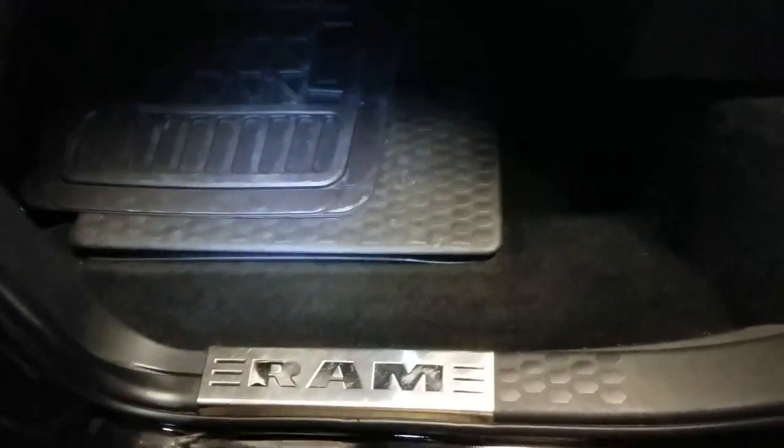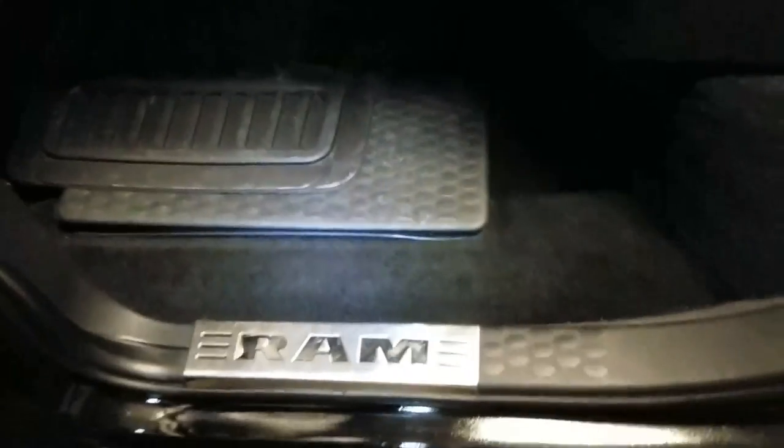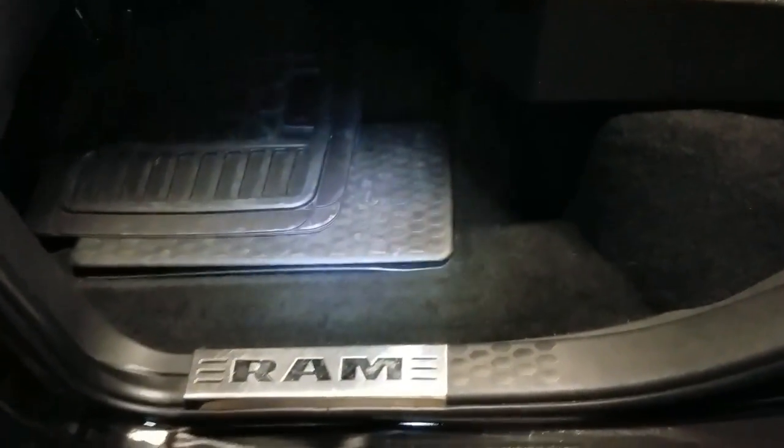It is oxygen free copper. I do have a step down that goes from zero gauge to four gauge to the amp, because the amp only accepts four gauge. The amp itself is installed in the storage bin here. The amp is a Rockford Fosgate Prime 1200D, and it fits nicely in there.